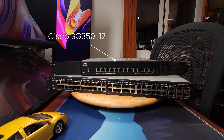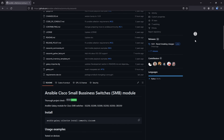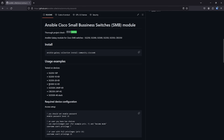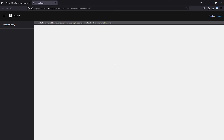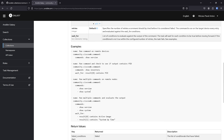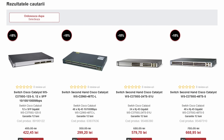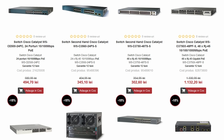My next failed attempt at network automation was when I got my first Cisco switch. I currently have two — the SG350 and SG300 — and they both support a limited version of Cisco IOS. While there is an Ansible module available for Cisco SMB switches, it doesn't really work as well as I had hoped. All the module does is allow me to send bare CLI commands onto the devices, and that's about it — there is no idempotency at all. Any idempotency I'd have to implement myself in the CLI commands. There are no specialized modules for common tasks like you'd get with the official Cisco modules, and as you might have guessed, these switches are not compatible with the official Cisco modules. To use those I'd have to shell out for a Catalyst or something, and those are generally pretty loud and power hungry since the only affordable models are older ones on the second-hand market.